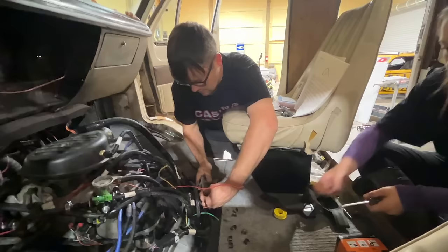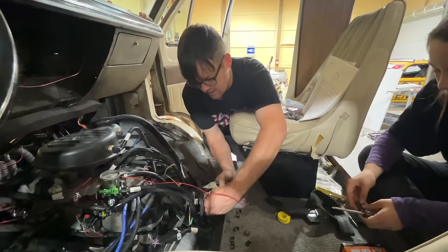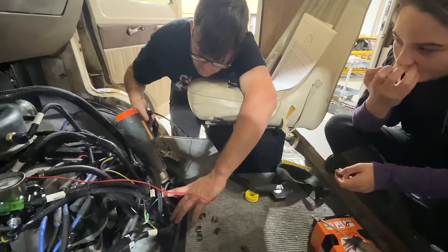Like the Super Coupe, I use this green wire to trigger a relay to run the pump because it has a Holley 450 pump. It's a lot bigger pump. I think it draws like almost 20 amps at peak. So I think this is an inline 255 Holley. It doesn't pull as many amps. Tell me if it's hot, Wash.